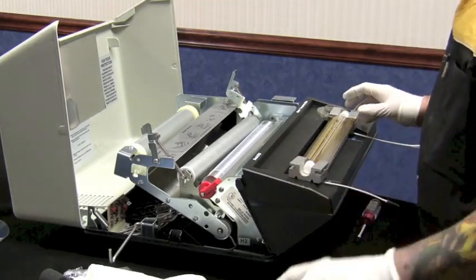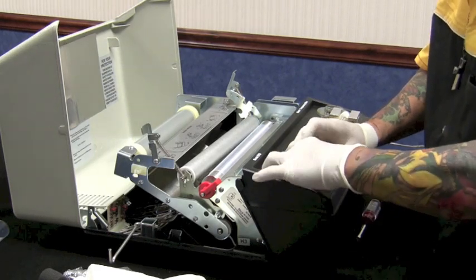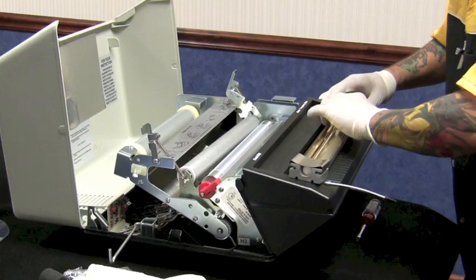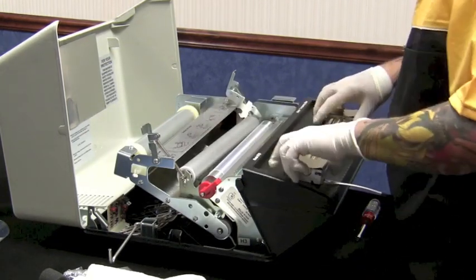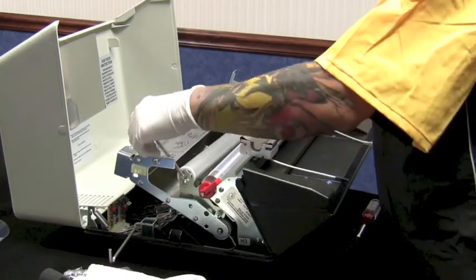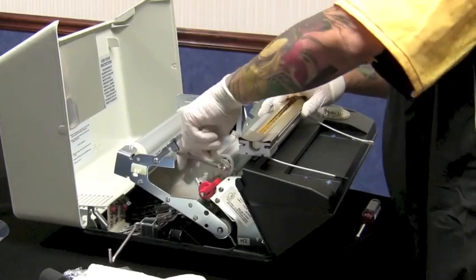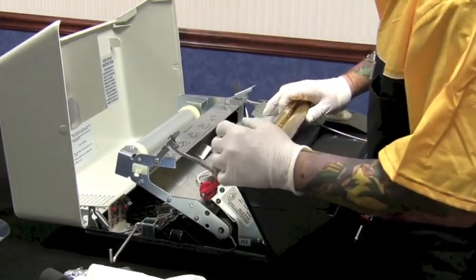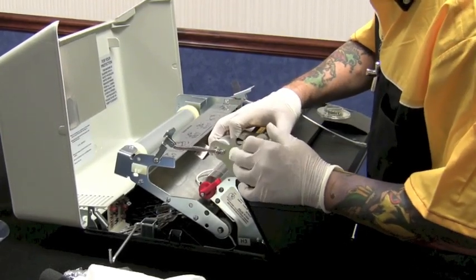I have both blocks in with my wires coming out the bottom — I will slide these back on. Now you're ready to put the reflector assembly back in. Once again, make sure your pins that lock it down into the frame are on the top, or your assembly will be reversed.